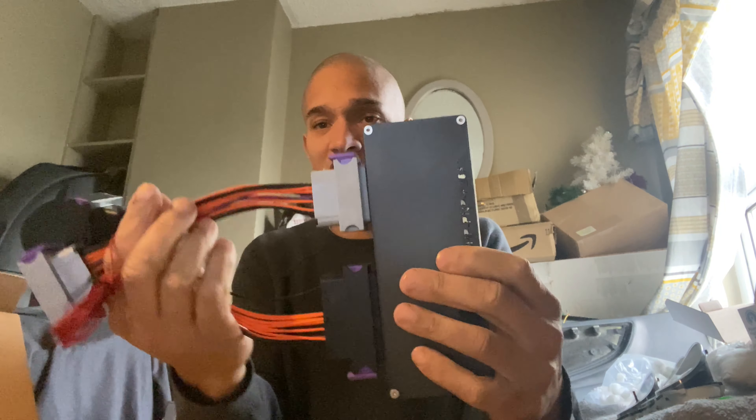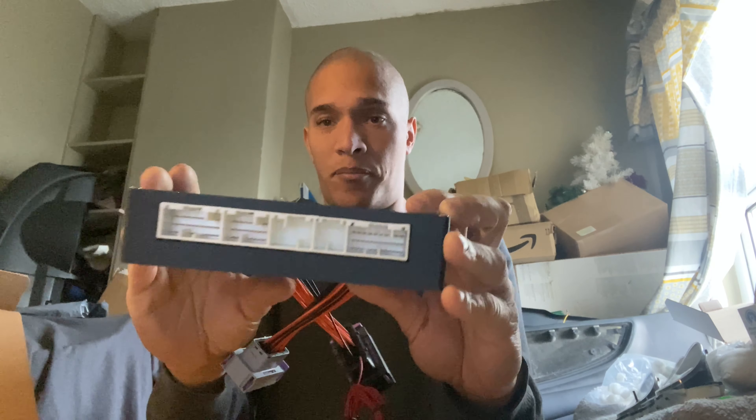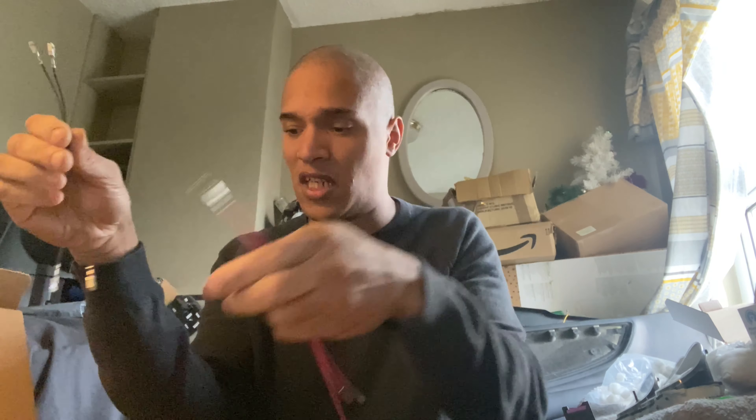This adapter is not really made by ECU Master — it's made by WHP, Real Horsepower as we like to call it. Here's the adapter; it's very big. Basically this part goes into your Honda engine side, then the back of it connects to the ECU. Then there are a few extra wires provided — I would say two are sensor grounds most likely, and the others I still need to figure out, but they appear to connect extra sensors that the Honda might not have by default.